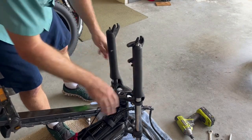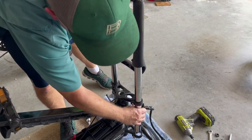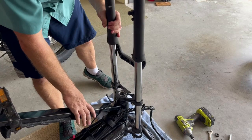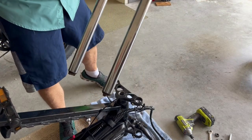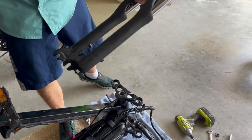It's pretty easy to remove. What you want to do is slide off these rubber bumpers and remember to reinstall those when you remove it. The factory shock is out — it's pretty heavy compared to the aftermarket one. These are oil-filled and not very adjustable.